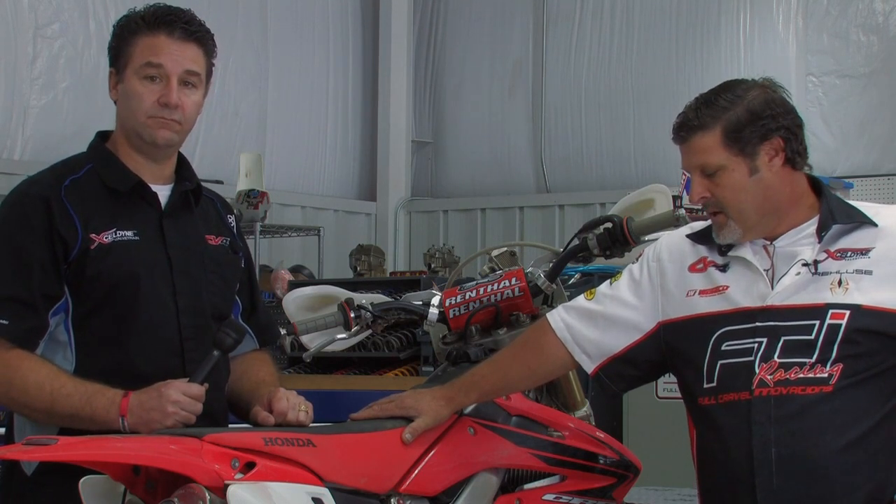Cal will talk about the suspension and engine build. It's going to be pretty simple — we do a lot of these for shorter riders. We'll do lowering kits for shorter guys in the woods; it's really hard to get your foot down when you need to, even on an e-start bike. We also do a lot of lowering kits for women. We've done kits for several gals in the local hare scramble association where they went from struggling to run with the guys — next thing you know, lower their bike two inches and they're beating the guys. We make that in-house. It's not a special link; we retain the stock springs so if they ever want to sell the bike and change it back, it can be done without spending a lot of money.